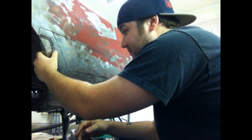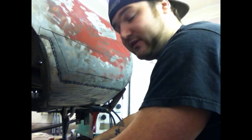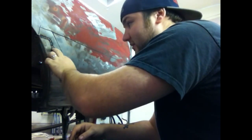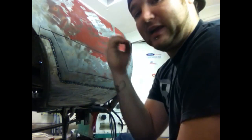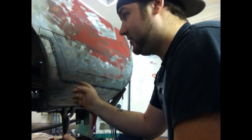Another thing: you might every now and then have a little bit of blowout. It's really common with butt welding and you can't always get past it. What you do is just fill it — as long as you don't make a huge hole, don't worry about it. You'll be able to fill it no problem with a little bit more weld.